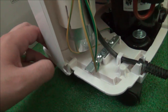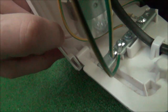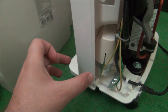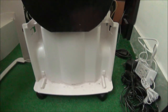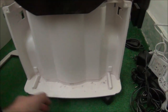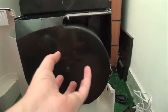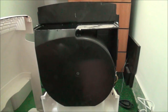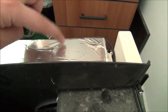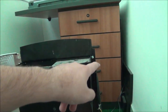Don't electrocute yourself - you just need to try this open just enough so it clears this space right here, and then this whole thing should start to slide out. As you can see, this is out - it slid out rather hard, so be careful about that. Now I want to take this out to clean the whole assembly in here and see if I can move the bearings of the motor itself to see if there is any sign of future trouble while I'm already in here. This thing does have an electronics brain box right under this, so let's get this out - it should have a few screws on the side.